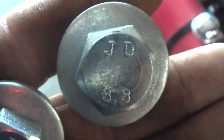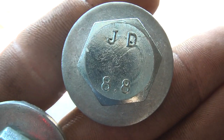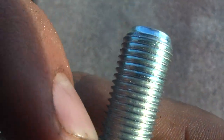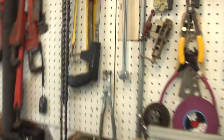Here's the bolts, and as you can see, they're metric. Got the 8.8 there — that's equivalent to about a grade 5 bolt in the English measurements. So we got 8.8 strength bolts here, that's pretty good. Not exactly sure what the threads per inch and exact diameter are, but these just go through on the hitch here, bolt up into the frame, tighten to 60 foot-pounds of torque with my torque wrench here, and then we're good to go.